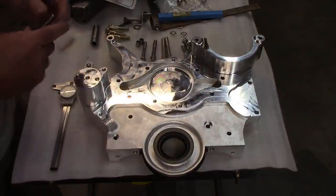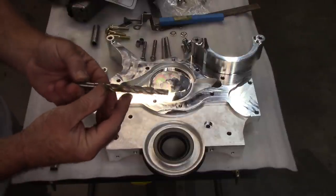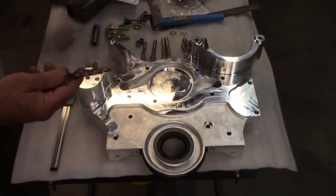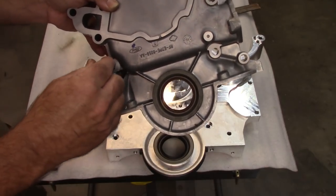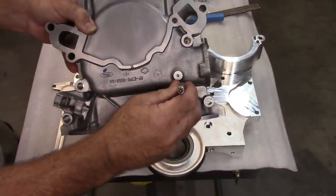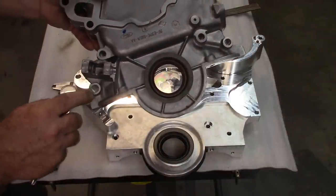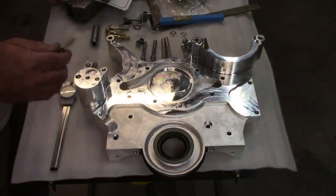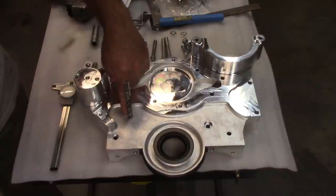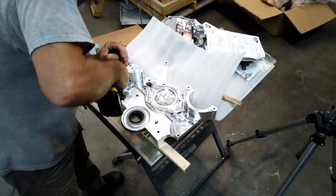Now, as I'm doing this, the plan is to use this step reamer. By chance, my neighbor, who goes by Hindsight67 on YouTube, if you've seen his comments on any of my live streams, he had one of these. And these holes, which are what's in the original piece, are, I think it's 420 is the size. And that's what I'm going to go with. I'm going to stick with that size. This one here is larger because that's where that shoulder goes on that timing bracket. And the guide is almost the perfect size for guiding the reamer in. So that's what I'm going to do. Step these up, and that'll take care of the holes in this part.